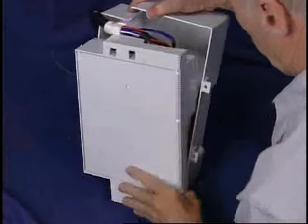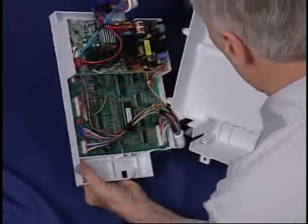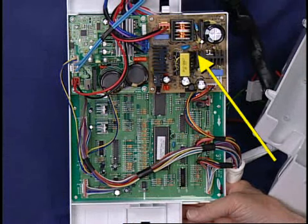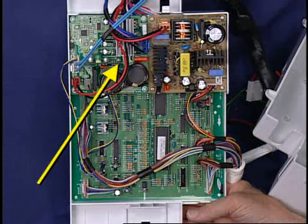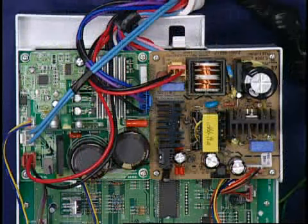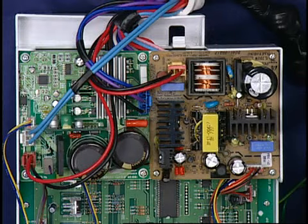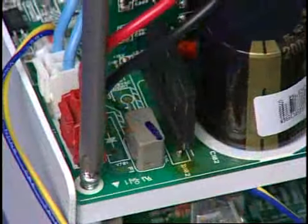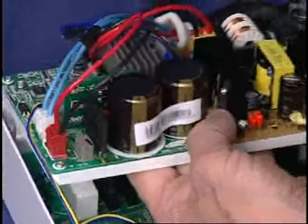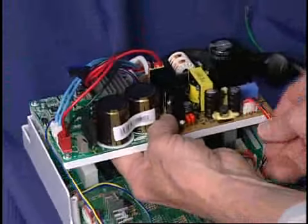This is highly recommended for board replacement. Note: be sure to protect the front of the refrigerator door when removing the housing assembly. Here is a close-up of the terminal block with the housing removed. To access the boards, pull the housing apart. Here are the SMPS (switch mode power supply), the inverter board, and the main PC board. To remove the main board, the SMPS and the inverter board must be removed first. The two smaller boards are mounted on a plastic frame — there are four screws holding the plastic frame to the housing.